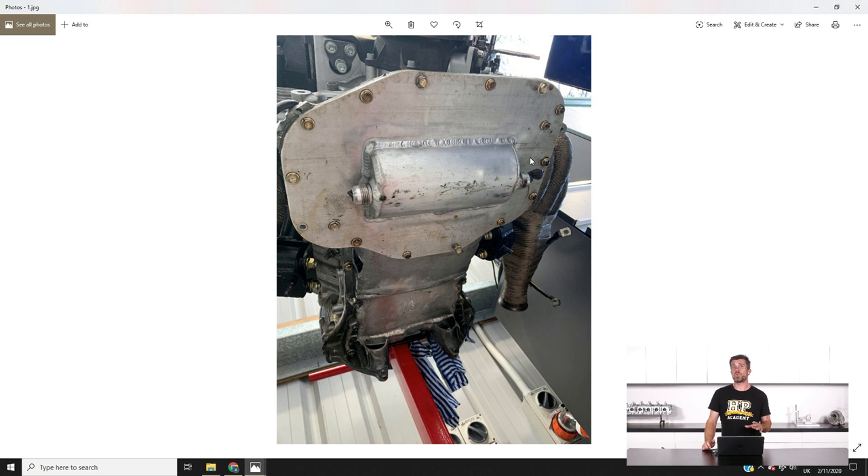There is actually a performance advantage as well. By drawing a vacuum and basically evacuating the blow-by gases out of the crankcase, what this can allow us to do is run a lower tension ring pack, giving good oil control while providing a small advantage due to reduced frictional losses. Evacuating that oil and oil vapour out of the crankcase can also reduce windage losses, so there's sort of a double win there.